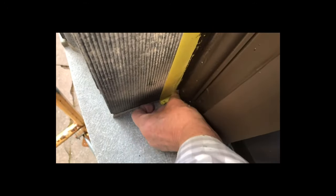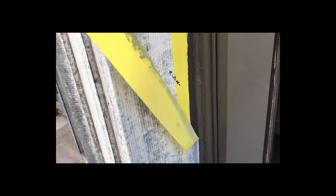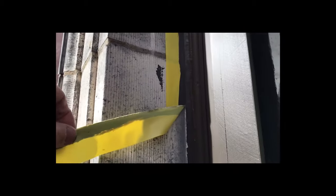There was some paint that was up underneath the tape. If that annoys me, it doesn't take much to go back and fix it. Now this is a failure right there and I'll touch that up. Sometimes you can see Top Gun 400 — it's Kevlar reinforced and clear. If you don't wipe it all the way off the tape, it's very elastic and will want to come off and pull the paint with it.